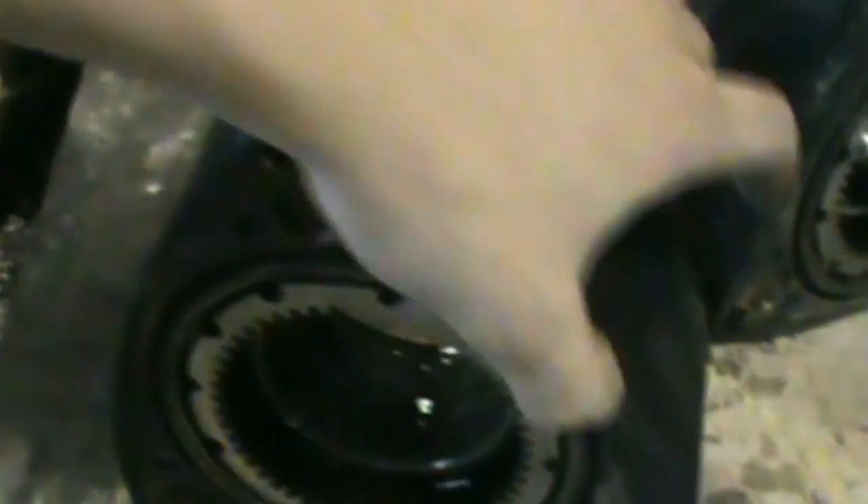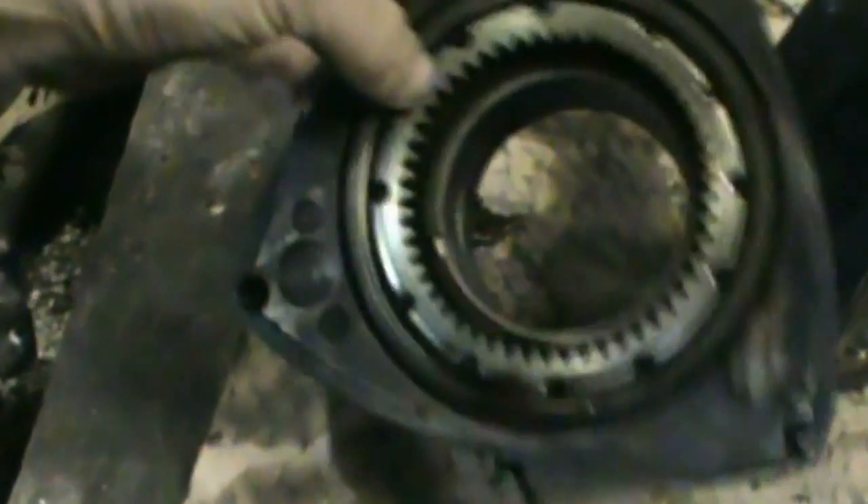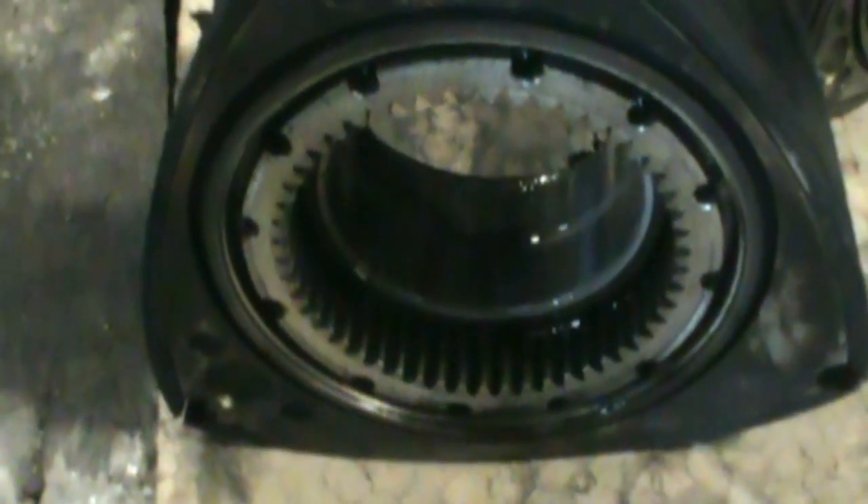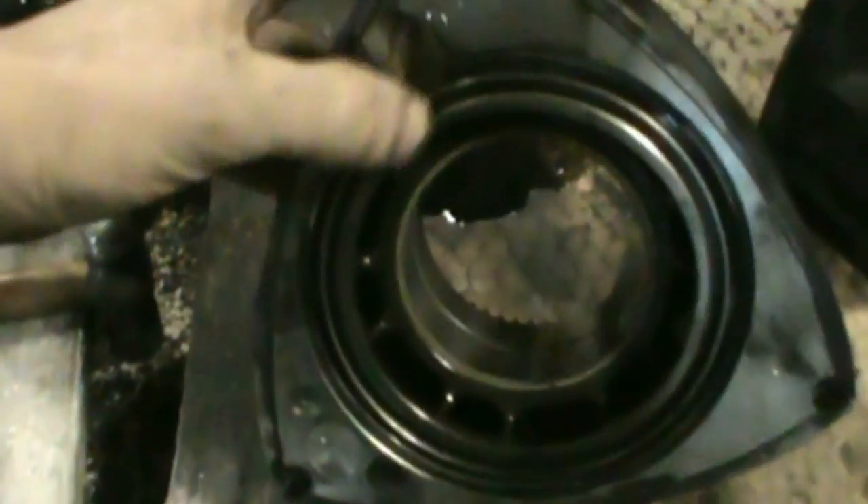Hey so it's a new day. I'm back at my shop and I'm just getting the rotors ready to start cleaning those, because those take the longest to clean. So I just got out all the side seals, put them in a bag and labeled them. The inner oil control rings came out when I took the engine apart, but I just have to pop these ones out — you just get a little screwdriver in there and you can pop them out. Got the oil control rings out, so it's pretty much ready to go start soaking. You can see the springs — one is a cream color and one is blue. They paint them because there's two different sets: one for the front of the rotor and one for the rear. When they're new it's actually white, but once you get oil on them it turns cream.